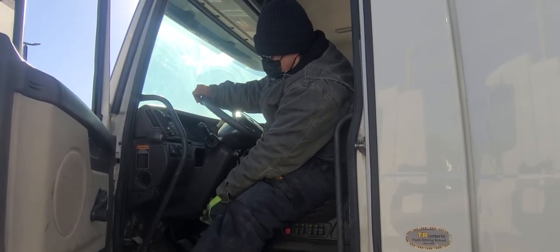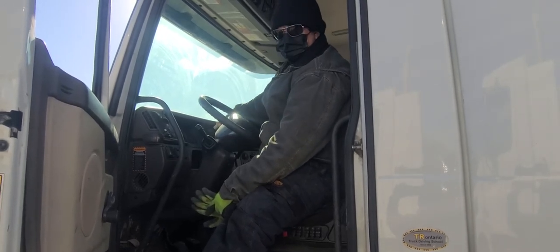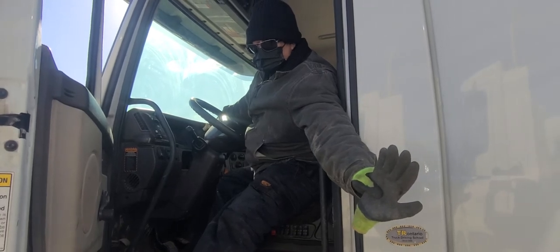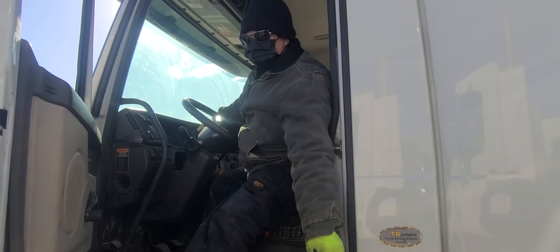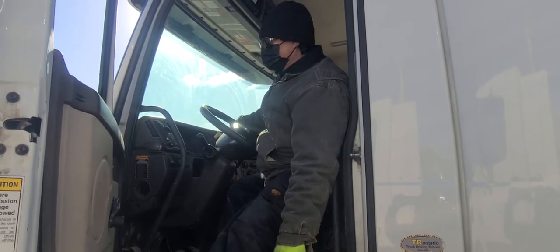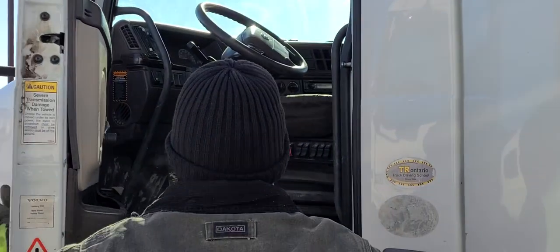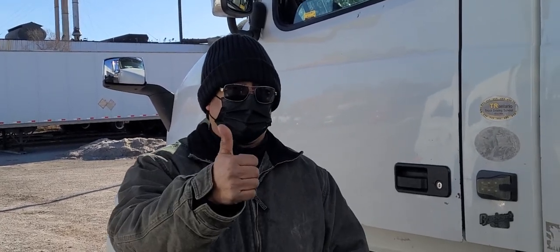Take the foot off the brake, pull out or apply your trailer brakes and listen outside the back. That is your trailer spring brakes working. So you're gonna tell the examiner my trailer spring brake is working. Now, you're ready to go for the road. You will remove the wheel chocks and the examiner will redirect you. Okay, I hope it works for you.